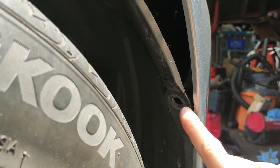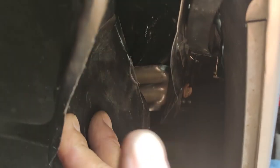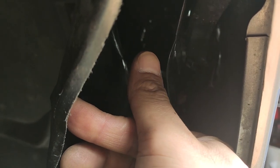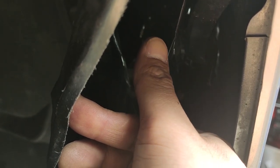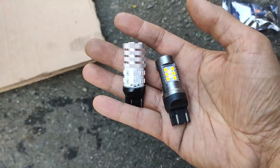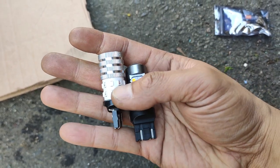Just to give you a better look at what's going on over here — you literally just have to pop this out and pull it to the side. I know it's a little dark but you should be able to sneak in and turn and take out the turn signal bulb by rotating it.